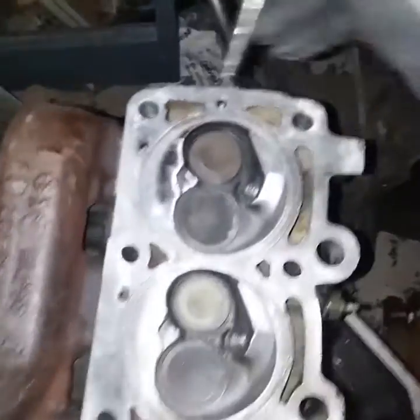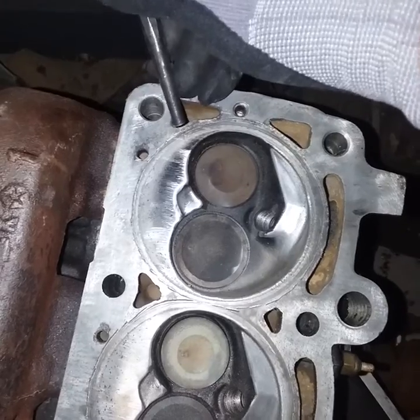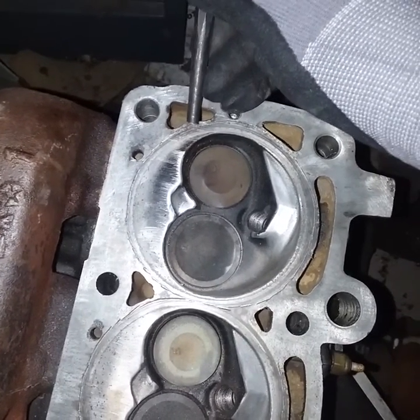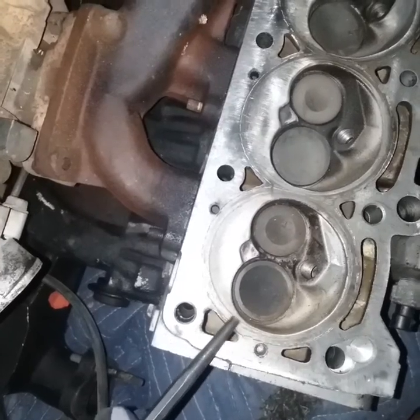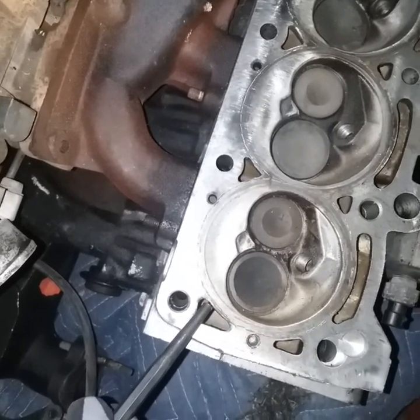Hello Richard. What I was talking about is taking a punch, lightly tapping across here on this inside. It'll lock in this compression ring because it's so thin here — you get boost up, it's gonna blow out in this corner. Then the next side will be this back corner over here. Just slightly tap and you'll feel a ledge build up right along this inside. Just barely tap.